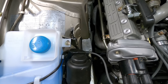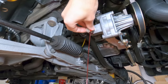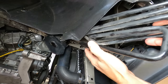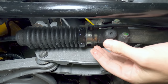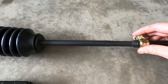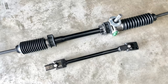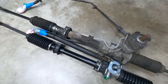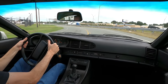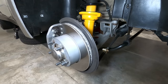Another change to discuss on this side of the car is the absence of a power steering reservoir, because I've deleted the entire power steering system and converted the car to manual steering. Prior to doing so, I had already rebuilt the power steering pump with all new seals and replaced the reservoir, but after a few years the steering rack developed a leak, and I was tired of dealing with seeping fluid connections. So I opted for a manual steering kit derived from a Mark 1 Volkswagen Rabbit steering rack with Volkswagen Scirocco tie rods and tie rod ends from the 1983 to 1986 Toyota Camry, which resulted in a weight reduction of 14 pounds. This kit bolts right up to the factory mounting points, though the modification does require a front-end wheel alignment. The manual steering is a little heavier at parking lot speeds, but it feels great once the car is rolling and feedback is notably better than the power rack.